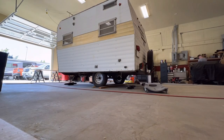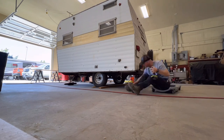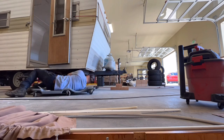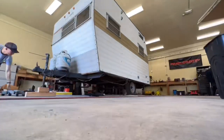This little camper was pretty bouncy when you get inside. The suspension was very soft, so we went ahead and bought some trailer stabilizer jacks. I found them on Amazon — I bought two packs of two and just bolted them to the frame of the trailer. They made a huge difference in the stability of this camper.